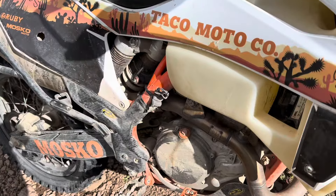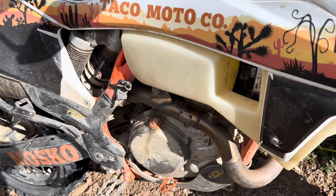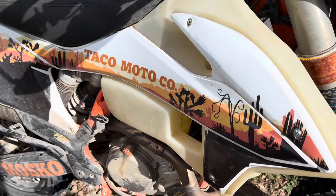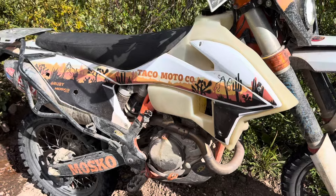After we've got the water out, put the spark plug back in. The tank is on. We're going to give it a test here. It starts right back up. So if you get all that water out, you shouldn't have any issue getting it restarted. Let the spark plug dry out.